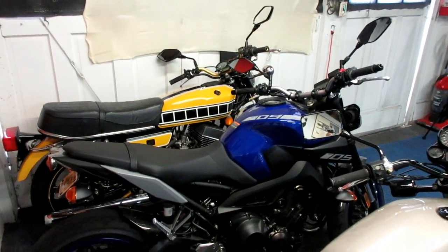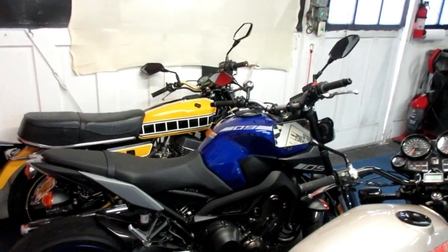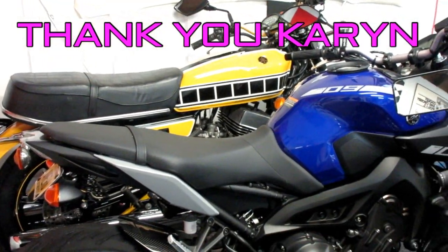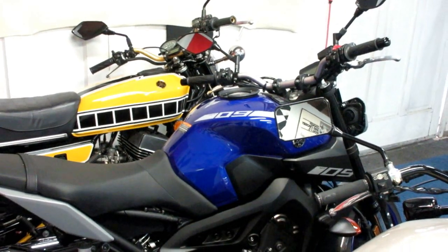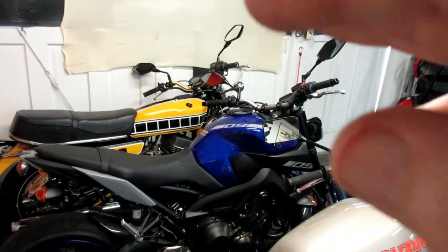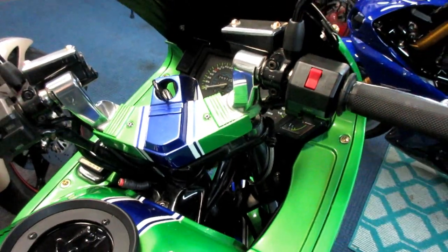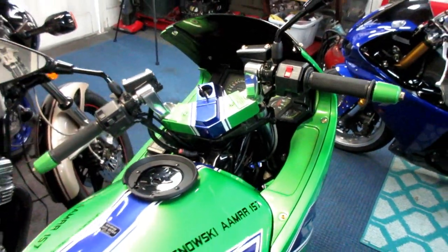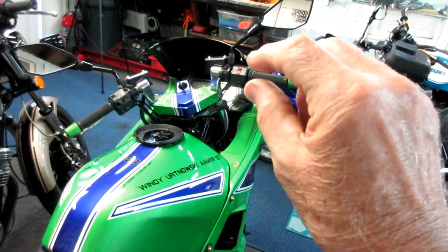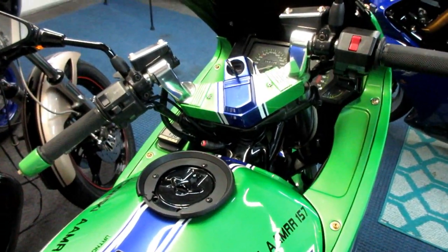One total surprise for me was when I bought the MT-09 — I got it for my birthday last year and it's got over 8,000 miles on it now. It was very comfortable: I had all the suspension settings on soft, the seat just about fit me, the handlebars were perfect. As time went by I firmed up the suspension a little, went to a little more air in the tires, and when I lowered the front end, that was just the amount I needed to make the bike a little less wheelie prone. As you lower the front end you're putting more weight on the front wheel and changing the ergonomics — it's the equivalent of lowering the handlebars by the amount you lower the forks. It's something you can custom tailor to your body type, riding type, and style.